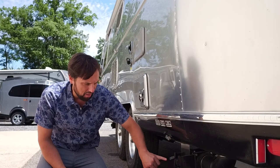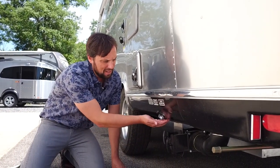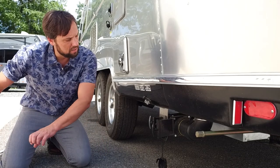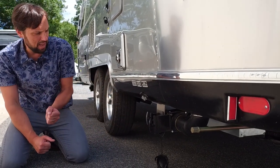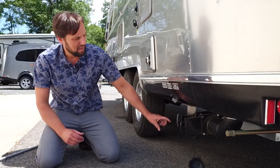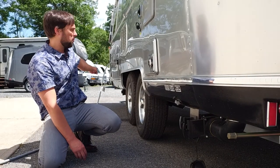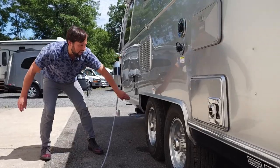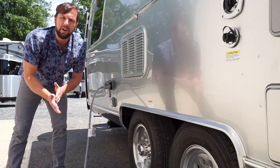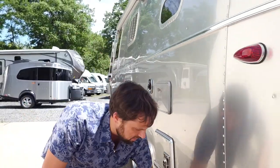The gray and black tanks are labeled by color — if you're color blind, they also say 'waste gray' and 'sewage black.' There's an LED light outside to illuminate this area. Snap the waste hose on and empty the black tank first to get all the toilet paper and solids through, then open the gray tank and let the soapy shower and sink water clean out your waste hose. When done, there's a waste hose storage tube up front. A little water dripping from one spot is the air conditioning condensation tube — it puddles right here, so don't think you have a water leak.